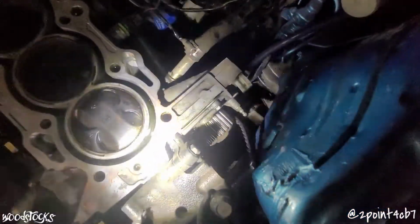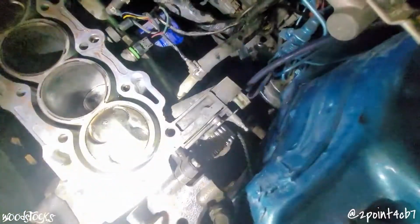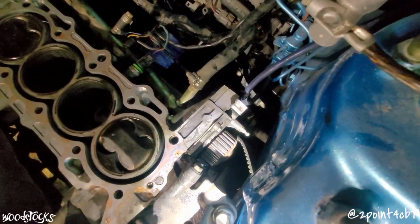The timing is where it gets a little bit tricky on this particular hybrid. I do not know if there actually is a true water pump that is just out of the box, straight bolt-on, that has the proper gear for this belt setup. But initially, I had to take the F23 water pump and pull the timing gear off of that water pump, and I had to press on an H22 water pump timing gear in order for that to work with this setup. So here we've got the F23 water pump with the H22 water pump timing gear pressed on.